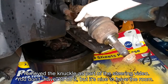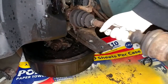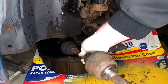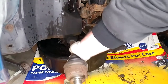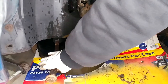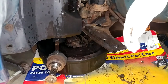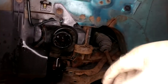This could be really exciting or really boring. I have a fun way of removing these — sometimes you just grab and pull and they'll come out. That one just split right in half, so that's not what I wanted. By the way, that's why I moved the drain pan. I'm not reusing these so I don't care. That grease looks like it had some water in it, so I think that boot was already failing. There's a Ford-specific tool to do this, but I found a way without that tool. Both require a slide hammer — if you don't have a slide hammer, you're kind of out of luck. There's nowhere to get any leverage around that stub to pry on it and pop it out.